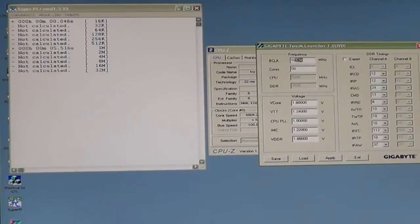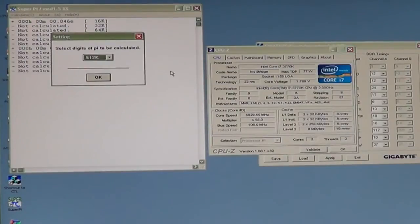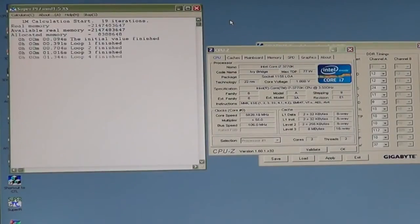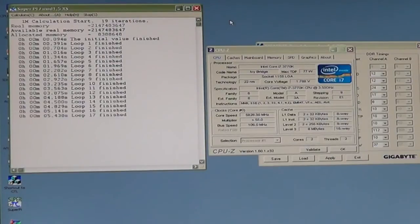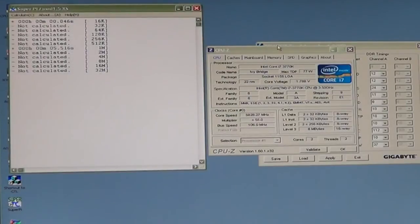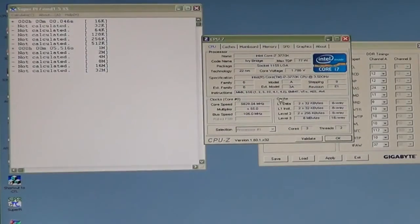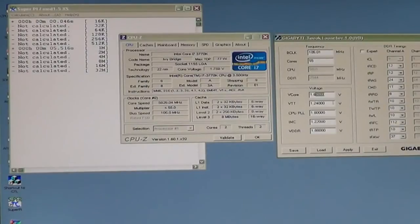Like if I go from 105.5 to 106, it'll bump it up by 20 megahertz. Then you test again. See if it's stable, see if it's stable, test again. If you start freezing, try taking your temperatures lower. If it helps, keep going. If it stops helping, if you get to maximum temperature, you can start tuning volts. And you can tune volts until that stops helping as well. Then you should not increase more.